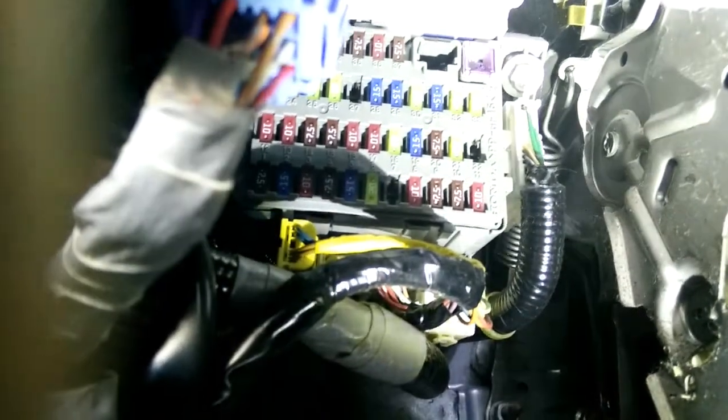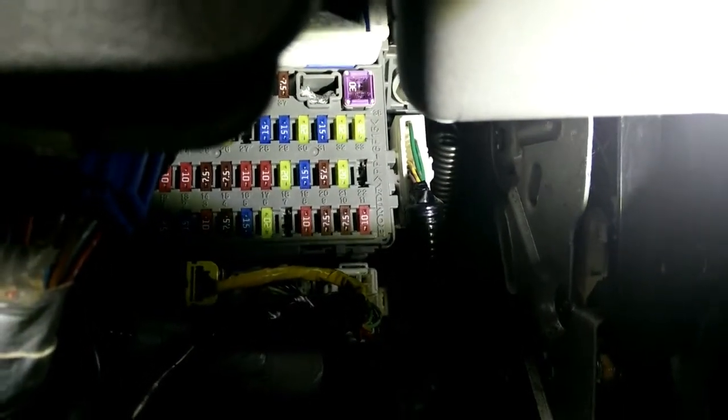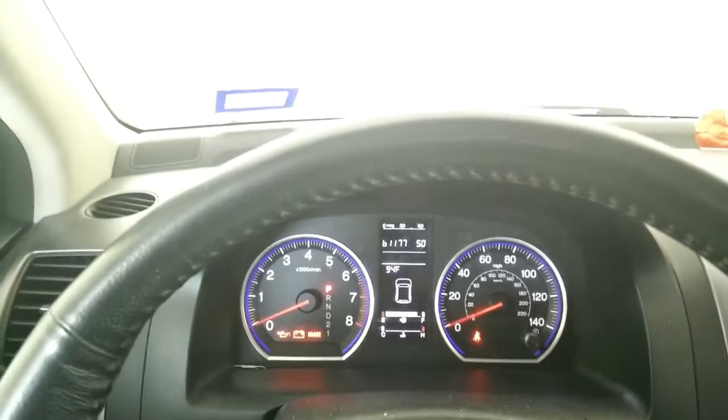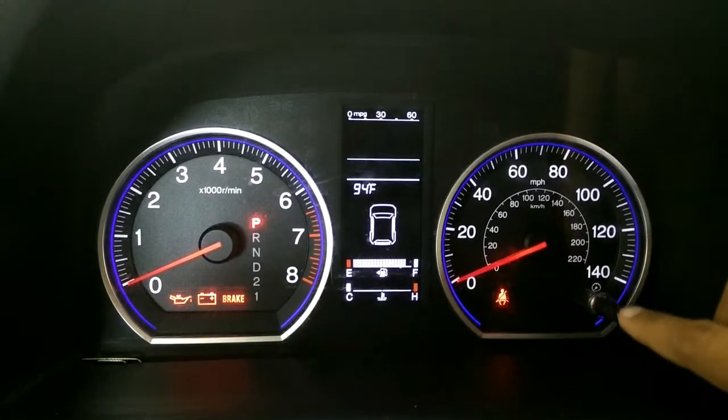I'm going to stick the aluminum foil in there and then check the light. I just want to show you that when you put the foil in there — that's how that looks. See, that's how you put the aluminum foil in there. The light blinked once and then you see the BCAN code flashing right here. Now what you need to do is press this select reset button, and you can use this button to cycle through the BCAN codes.